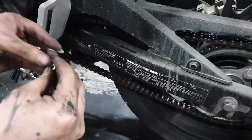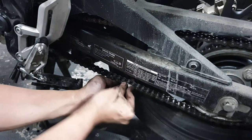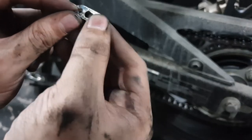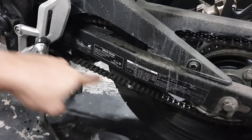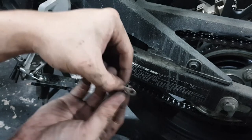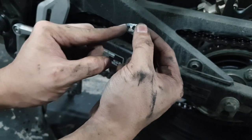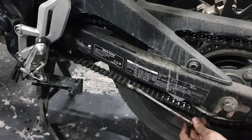So I got the rest of the master link here. The outside is painted so I'm gonna keep that on the outside. Put it like so. For the lock clip, first determine how the chain spins — it goes in that direction. So what you do is the opening, or the unlock side, should be opposite of the rotation. Since the chain goes that way, we install the lock like this. The logic is: since the chain is spinning in that direction, if a rock hits it while spinning, it won't bump it loose. If you install it the wrong way and a rock hits it, there's a chance it can knock it out. So let's knock it back on — there we go, locked. Chain is locked.